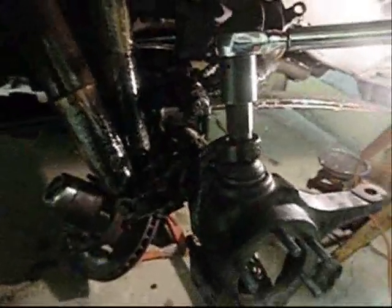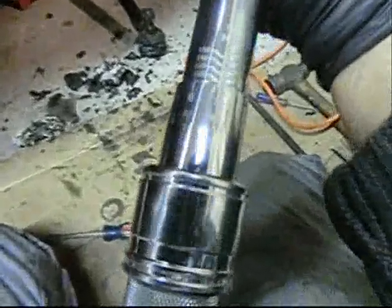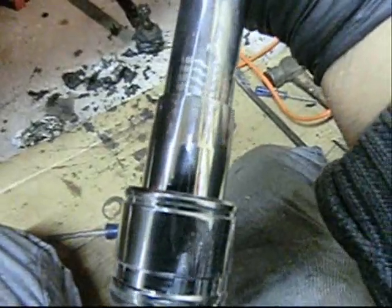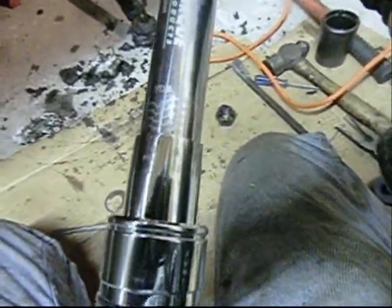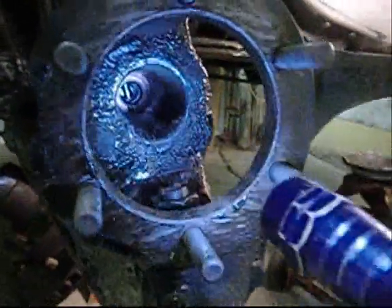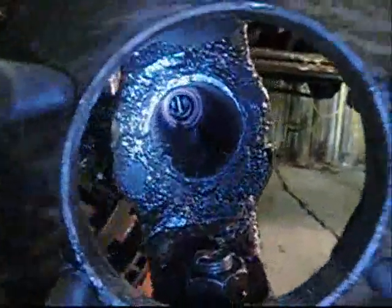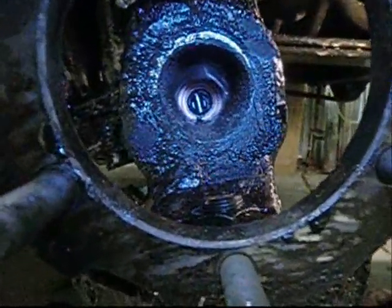I really should push down on that — I've already pre-torqued it. Click. 70 foot-pounds. Laser etched. Now I'm going to slide the axle through that slimy tube. I don't know why they don't put a seal on the outside, but I guess GM is not thinking about Dana 44.